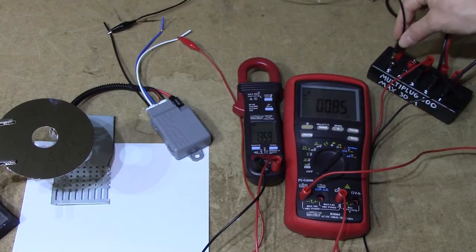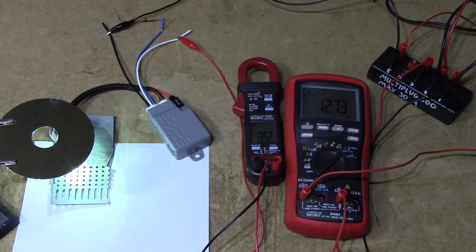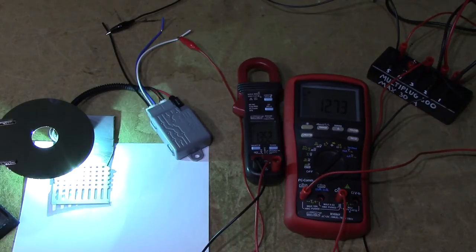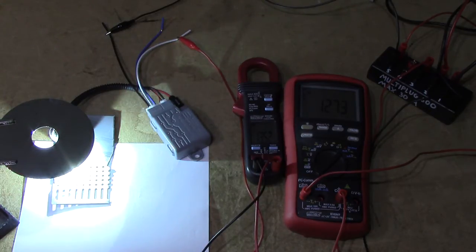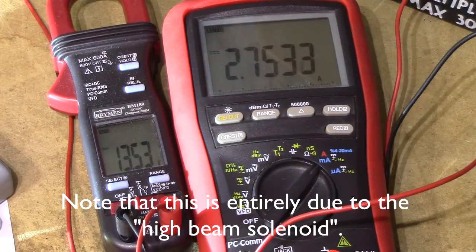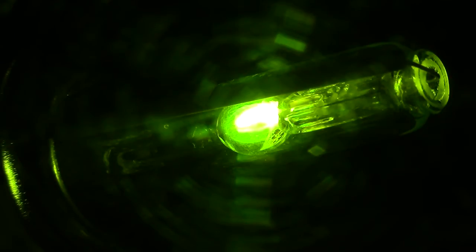It fired up and peaked at 12.73 amps. For reference, we are at roughly 6000K lighting in this room, and to my eye this light is slightly bluer than that, although it hasn't warmed up yet. The power consumption after the light has warmed up for a few minutes on the low setting is about 32 to 33 watts, which makes me curious as to what the high setting is going to give us since it's supposed to be a 35 watt light. And the answer is not a whole lot more — we're getting an input power of about 37 watts. Here's a view of the arc as well as my cheap video camera and welding visor can manage.